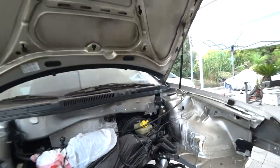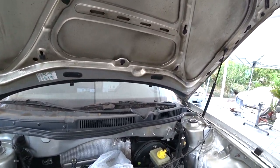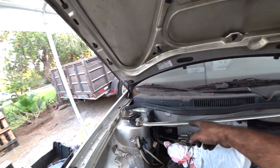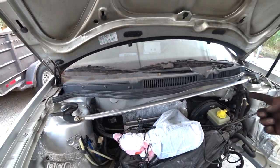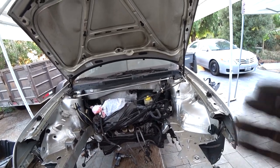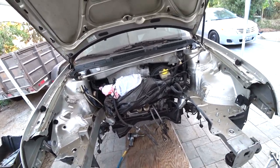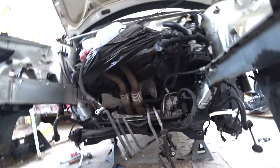Usually I just have a metal bar that goes across and hangs on top of that — we'll have to figure something out. I know what I can use — we're going to use the strut brace that we have here and just use that to tie some rope around it to hold the rack and pinion up. It's just a safety precaution so you don't damage stuff down the road. Underneath the rack and pinion is held together by four bolts — I think 13 millimeter. These four have to be removed first, then these big beefy ones.